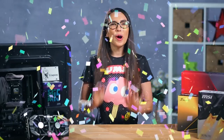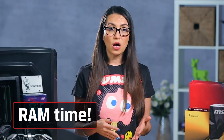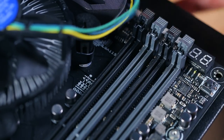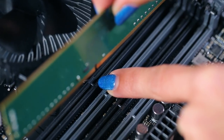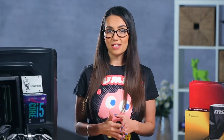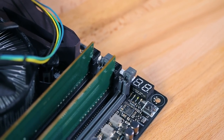We did it! With the hardest part behind us, we travel onward to our destinies of sweet PC perfect bliss. Next item to install on the motherboard is the RAM. Start with the slot marked DIM-1 or Bank-0, then open up the clips at either end of the RAM slots and align the notch in the memory connector to the raised key in the RAM bay. Not lining this up properly could damage the memory, so be careful. Push the memory firmly into place and the clips will lock back in. If you're using multiple channel memory, you will need to install the memory in the proper channels to get the expected speed boost.